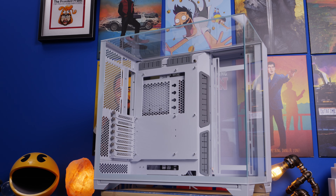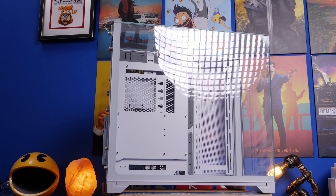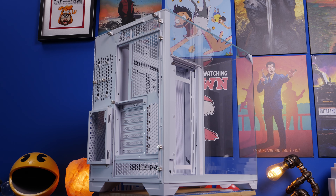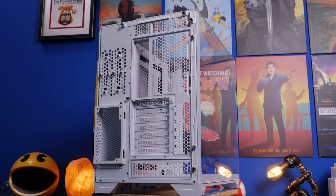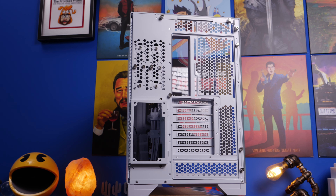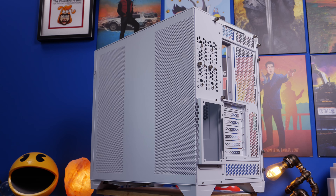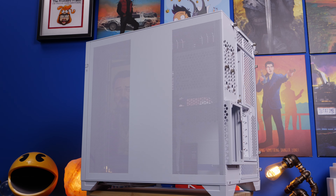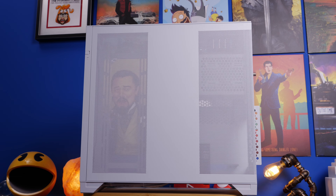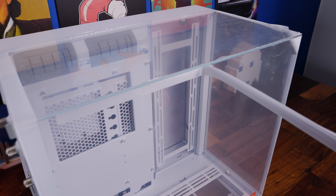This is a very nice case with a lot of glass so you can see into it quite well, but the options for installing parts are a bit more limited than other Lian Li cases. Although you can fit a 360mm radiator on the side panel, the top panel is glass so airflow needs thought. I ended up with six intake fans and two exhaust on a 240mm NZXT radiator. All specs will be in the description.